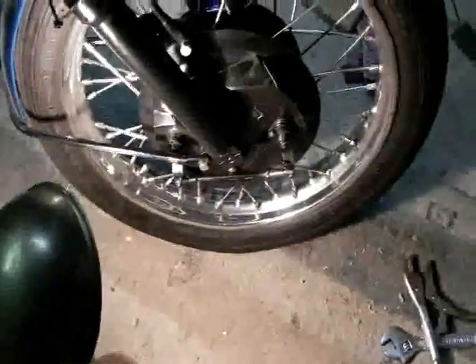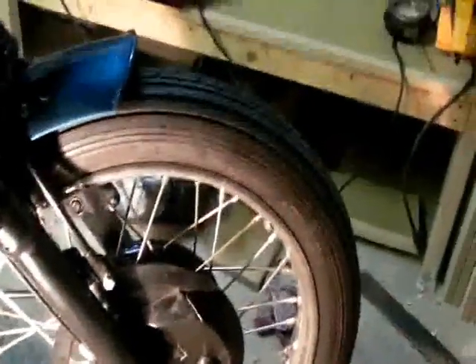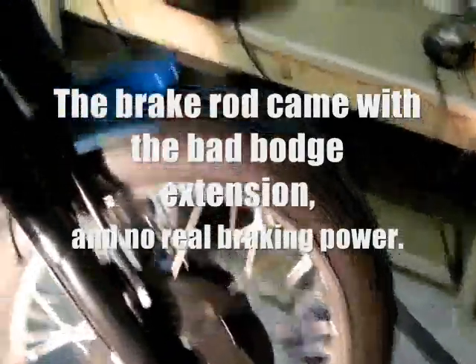Look what I found in the bolt box — I found an 8-inch brake lever, or brake rod, so we don't have to use that little bodge piece I had brazed on before, all that work. This is temporary; I want to get a proper 8-inch and get my spare back. Up here, the way the handlebars were set up, even when the brake wasn't working, it was interfering with the throttle right away when getting down to the grip. I like my throttle cables dropping directly below the bike, straight down 90 degrees. Make sure you Loctite these as well.